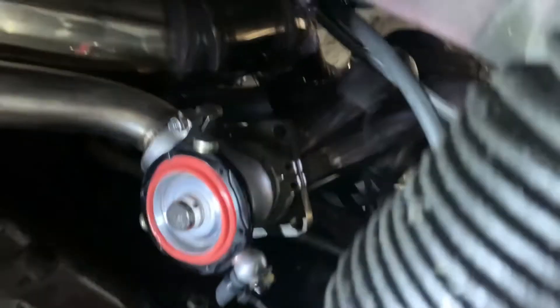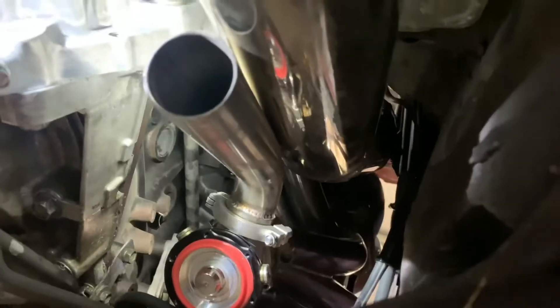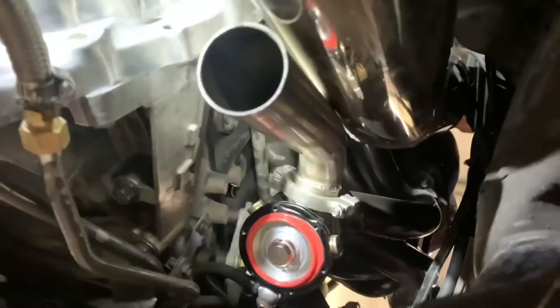Matt's taking a look at the pipes to find a quick temporary fix for the exhaust rattle. The suggestion is to loosen the v-band clamp at the base of the wastegate and rotate the whole wastegate clockwise a little bit — that'll push the dump pipe further away from the downpipe so they stop touching. It's just a little allen bolt on that clamp. That should work famously and we don't have to do anything complicated.